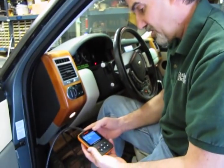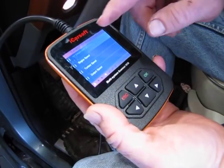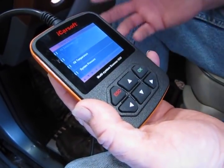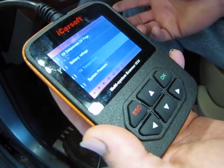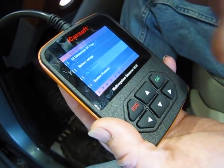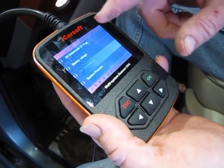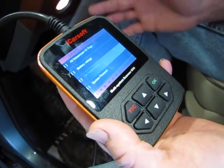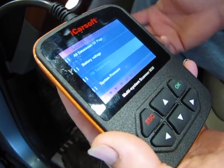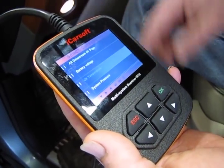What we can do with a lot of these tools is go to live data or data streams and scroll down to where it will give you your actual temperature. Now if the vehicle has been sitting for a while, the temperature should essentially be about the same as the ambient temperature. We have a new unit in this already so it's not going to show up — we've already done the replacement, but I wanted to show you how to access and test it. If it tells you that you've got 160 degrees Celsius and the vehicle's been sitting for hours, definitely the sensor is misreading. As the vehicle warms up it goes beyond range and determines that we have an overheating issue — generally it's just the sensor.